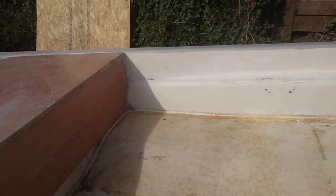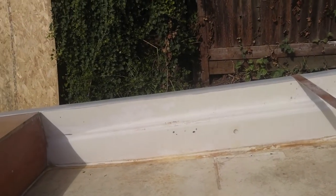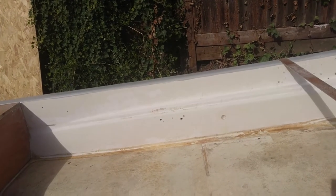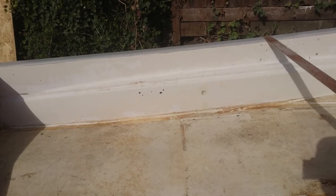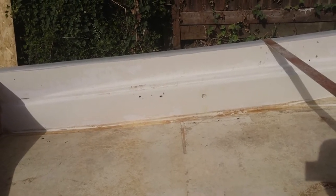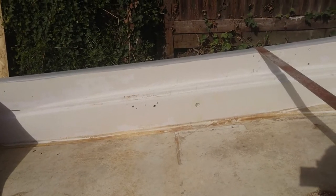You can see down the bottom it'll run. That hole that was a bung — it was a modified handlebar bung, the bit that goes in the end of your handlebars on a push bike, which had a hole in it. No good at all. So I dug it all out. There's some residue and a bit of mould, but it's dry. I mixed up some A and B expanding foam, made myself a little funnel with some tape, poured it in, and quickly taped it off to fill the hole up.